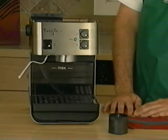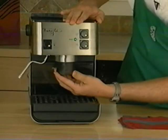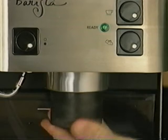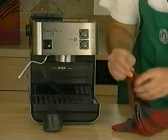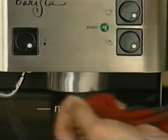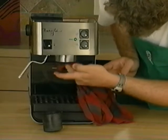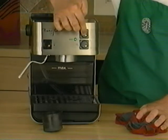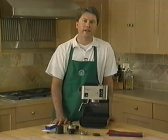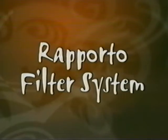Once the machine is cooled to the touch, you can proceed. At least once a month you should clean the coffee grounds from the brew head using the brew head cleaning tool included with your machine. Insert the brew head cleaning tool into the brew head with the T side up. Turn the cleaning tool to the left and to the right to remove any large coffee particles from the brew head gasket. Remove the brew head tool, then take a damp kitchen towel and insert it into the same brew head area — a damp towel will work just as well if you don't have the tool. This will remove the smaller, finer coffee particles that sometimes get stuck in the brew head. Continue to clean with the towel until there is no discoloration on the towel. Plug your machine back in, turn on the power, and depress the brew switch. The water will come through the brew head and remove any excess coffee particles.